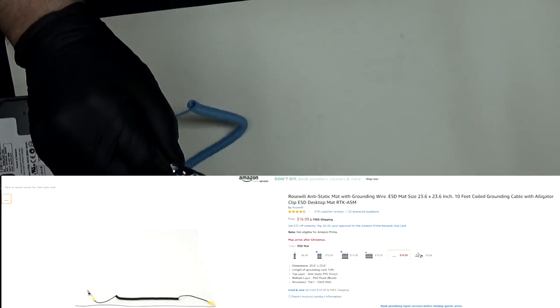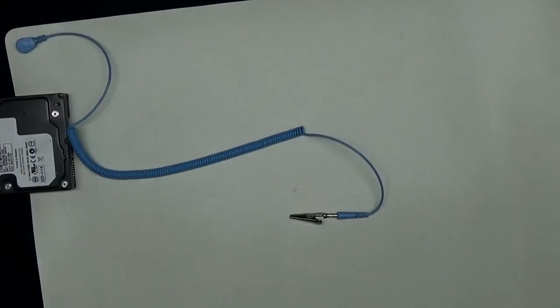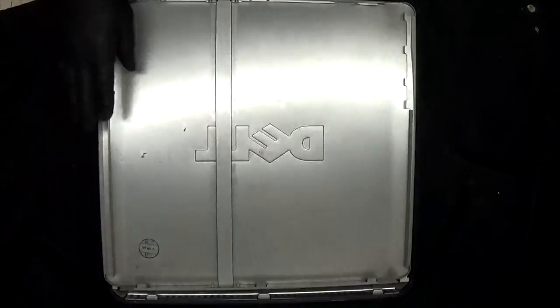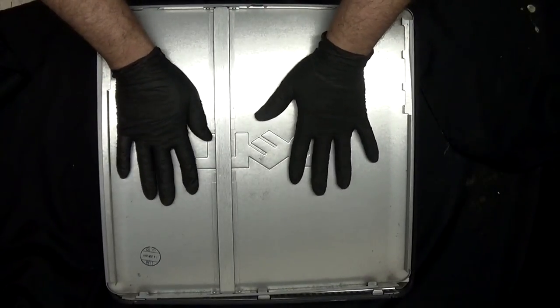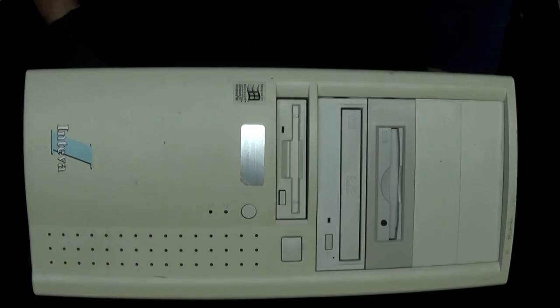The next one is a mat. I can't show you the whole mat, but I'll leave a description in the link below. Again, you can put the components on this and you prevent getting an ESD. The next way of doing it is just touching the outside or the inside of the computer cover without gloves on. That will take the charge off your hands, so when you touch something, you won't shock the components inside. So let's get started and let's take apart our first computer tower.